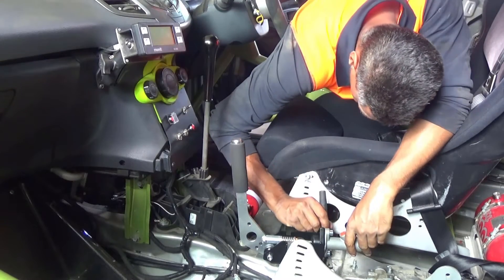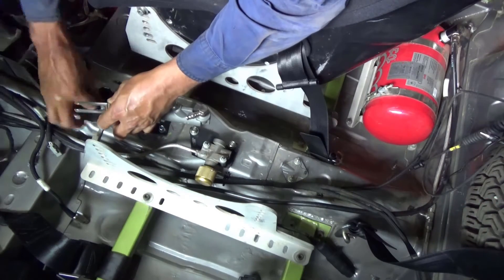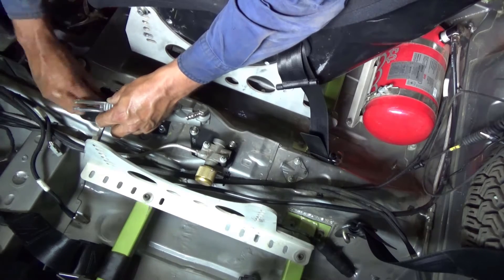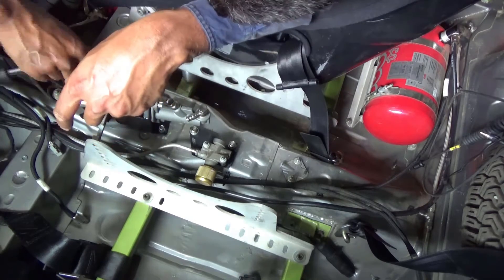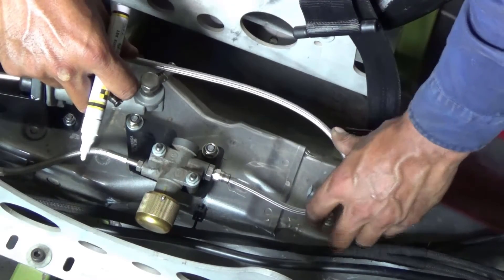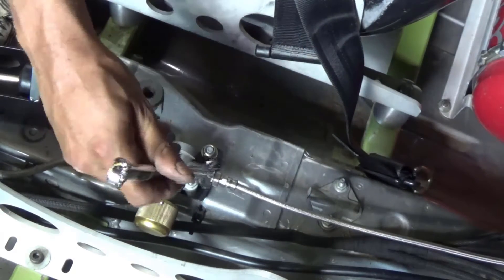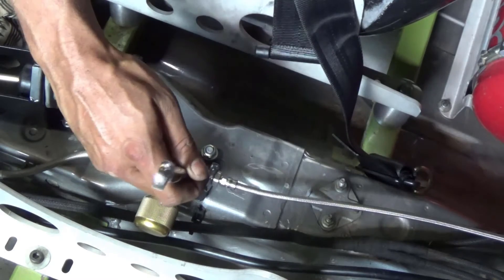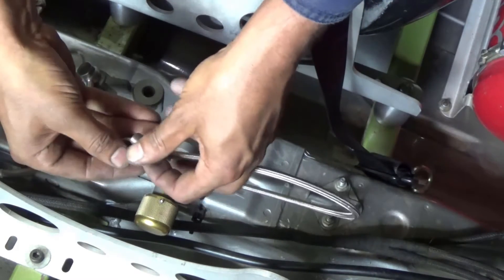We use these types of hydraulic handbrake — the handle can be fitted in either a vertical or horizontal position. We placed the handbrake assembly on the floor and in this case were able to use two of the factory threads that already protruded from the tunnel, so we only had to mark and drill another two holes. With the holes drilled and the floor tapped, the bolts were wound in from underneath the car, making it much easier to drop a washer and nut over the top and tighten up without getting under the car again. Next we made up the hydraulic lines — all from Dash 3 stainless steel braided hose and speed flow fittings. You can use hard line and a flaring tool which is cheaper, but flexible hose is much easier to work with and neater. We started by tightening the straight fittings first, then placed the banjo fittings on the handbrake master cylinder and tightened it all up, and fitted a rubber P-clip to hold the line in place.